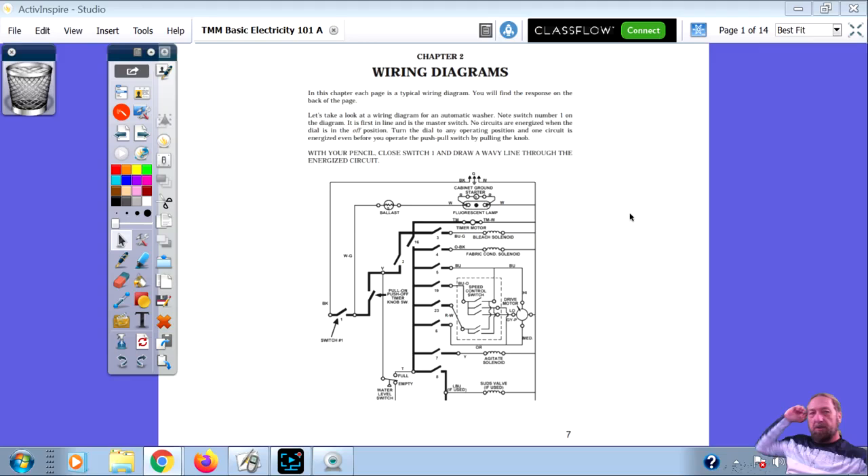So this was a package created by Whirlpool to practice schematics and diagrams, but I also want to continue with what we talked about — voltage, ohms, watts, and amps — and how do you use them when you're troubleshooting. One thing I always stick to is voltage testing is going to be the best way to troubleshoot an electrical circuit until it becomes unsafe.